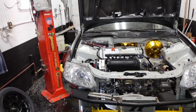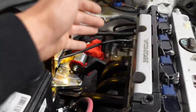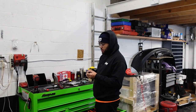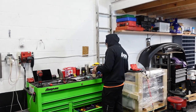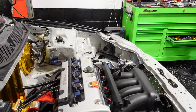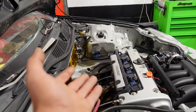We had no leaks. We had no intake manifold leaks, no exhaust leaks here on the header. This header is not it, Trap. I think it needs more coating. I think it'll get us by, but I think it needs two more coats. I'll talk to Mike about it because that thing got really hot within a span of 15 seconds. Yeah, a few seconds it was hot already. And we're running corn, which is a cooler fuel, so we shouldn't have felt it heat up that bad.